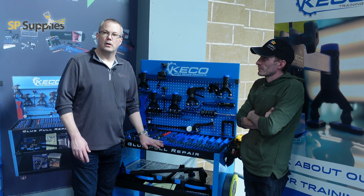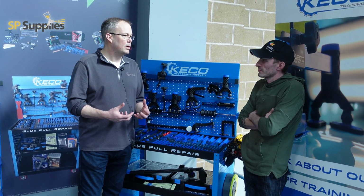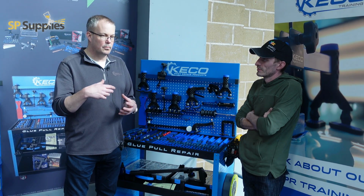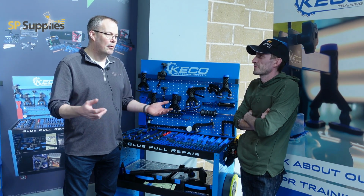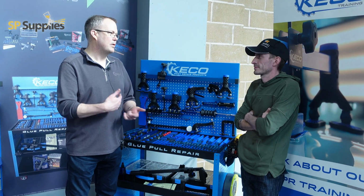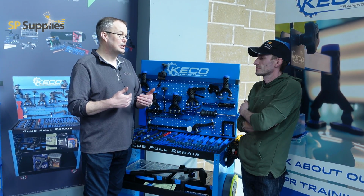What are the pros and cons of glue pull? Well, there is no cons. It's purely down to understanding the system, how it works. We support guys out there doing this day-to-day to try and get the best out of the kit, and get the best pulls possible. The power thing is always number one. Is it strong enough? I'm welding something on, how can gluing something be stronger? Well, if we think about how cars are built now, panels are being bonded. We're just doing the same, but on the external side.